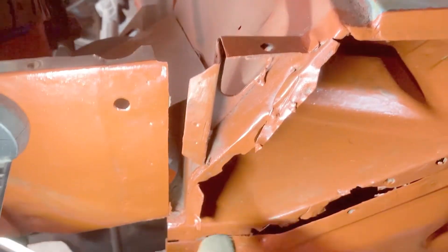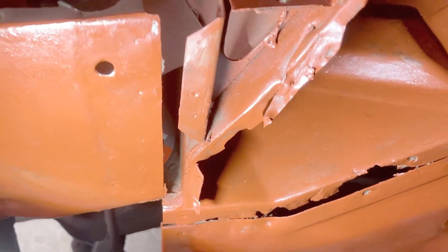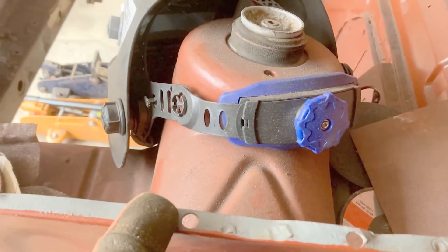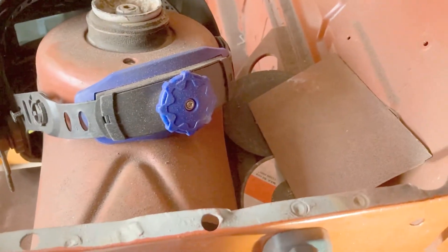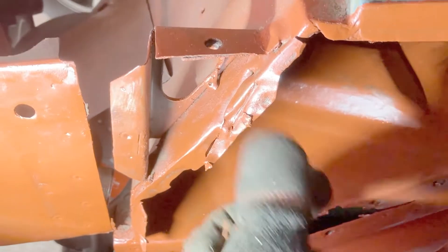I'm just going to start off small, probably work on this rail along here. I'll straighten it up and see what I've got to work with, see what needs cutting out and replacing. I might also look at these - thinking of chopping squares out and welding new square tabs back in rather than replacing the whole rail or cutting little circles to weld in.